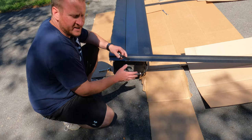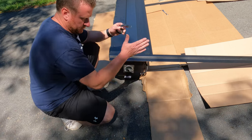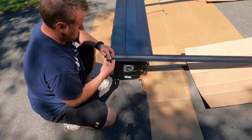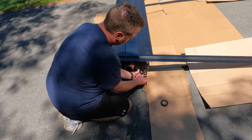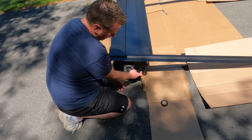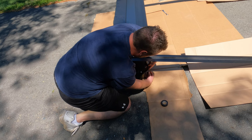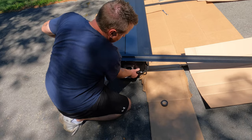On the driver's side is where the wiring is. I took some electrical tape and taped the wiring loom to the side of the canister just to keep it tucked up out of the way so it doesn't get caught on anything as you're setting the canister down into the bed. There's one wire labeled 'power' — tape that end to the front of the canister. That way you'll be good to go when you get to the wiring section.